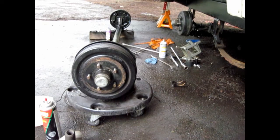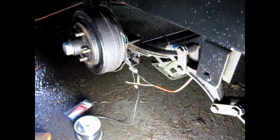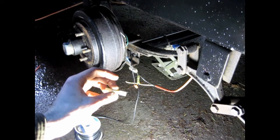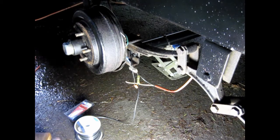Getting ready to roll the axle back under there. It should go without saying these things are directional — the brake wiring obviously has to go on the same side it came from. Rewiring the trailer brakes, I'm using these insulated butt connectors — you can get them from O'Reilly's or wherever, they work pretty darn good. You heat up the insulation on the outside and it's like shrink tubing; it'll shrink down and make a pretty much watertight seal. I feel like I got kind of lucky on the leaf spring perches — I wasn't sure if the leaf spring center pin fastener was going to fit into the indexing hole in the perch, because it was the nut that was going to be going inside that hole. But it fit just fine. If it hadn't, I would have had to pull the leaf spring center pins out and flip them around the other way — more work, but you could do it.